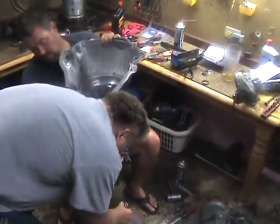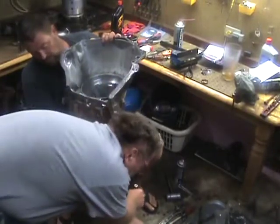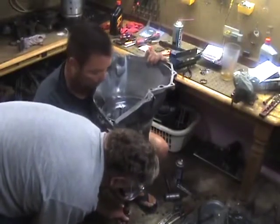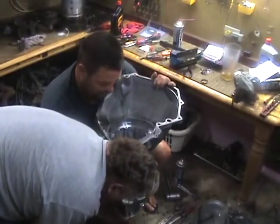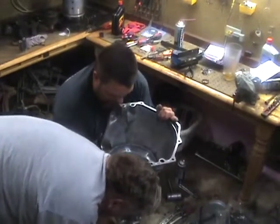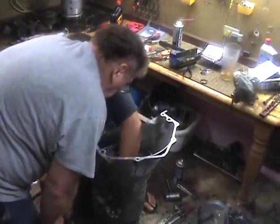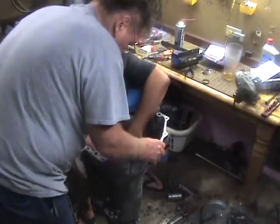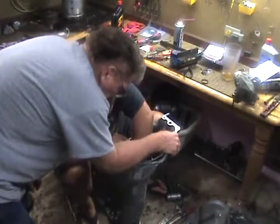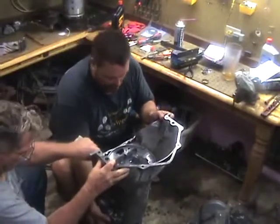Here we're just taking back out the actual shaft, and what you can do is put the casing on top of the shaft, so that way you can lean it up against a table or whatever, but we wanted the shaft left in there ready to go. So I'm just sliding it down and putting that in there. Then I turned it around, and what I started doing was we got the first two gears in, so I put that first gear in, and then I put this sun shell in there, and then there you have that brass bushing that goes in. Went ahead and put that in there. So we got that all done.